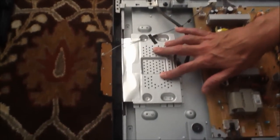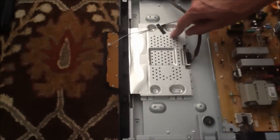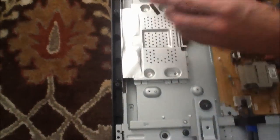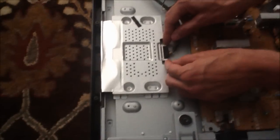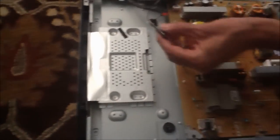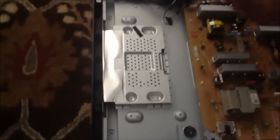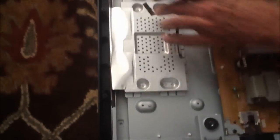There's usually a piece of foil tape near it, so that's the best way to identify it. What we need to do is go ahead and open this up. In this case there are four screws and there's a little piece of tape here connected to the top component part on this television. I'm going to disconnect this lower cable. These are the cables I already pulled off and put back on — I reseated them to see if that resolved the problem, and it didn't. So I did have to order a new T-Con board.